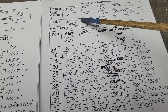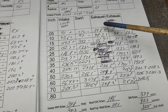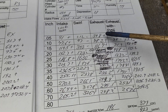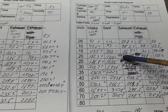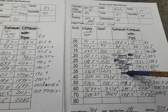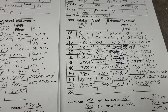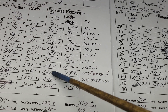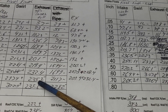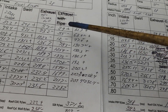Let's go to number seven. Our intake port did a little bit better, really well around 300. I would imagine this is going to do better through the intake manifold - plus, it's all the way at the end of the plenum so the air has plenty of time to straighten out. Plus, plus, plus. This is 152.6, this is 182.6, this is 203.5, this is 220.2. These you can actually read - we top out around 245, which is excellent, definitely a little bit better than this port. A huge amount? No. 235.2 versus 245 - that's 10 CFM, more than I would have expected.